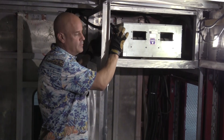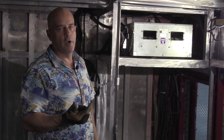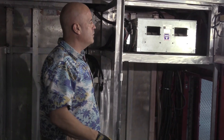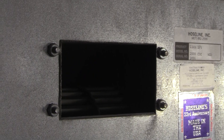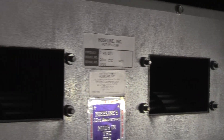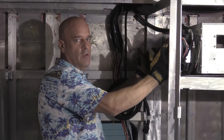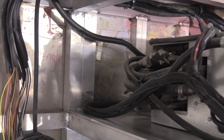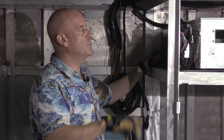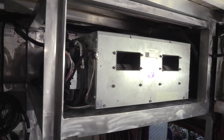The way this system works — it's a hose line air conditioning — it works really well because it runs off the inverter, off the truck, or off shore power depending on how it's set up. This will be the exhaust for the AC, this will be where the cold air comes out, and this will get plated over with two directional vents. On this side, warm air goes in, gets sucked through the back of the unit through the coil, and blows back out the front — creating a big circular cooling system, which will work really nicely with the AC being high up, since cold air goes down.